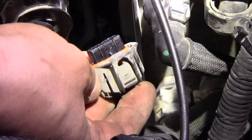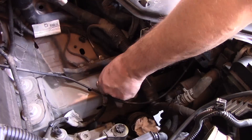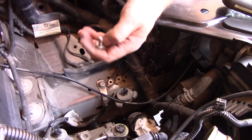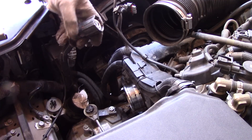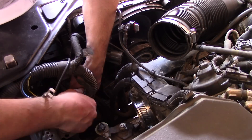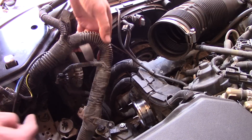Just push on the top and pull on the connector. Next, remove two ground cables from the chassis — there are two 10mm bolts. Take out the bolts and loosen the two ground cables. Next, disconnect the fan connector. Now we can pull the wiring harness upwards — but be careful, there is a plastic clip that secures it to the car frame, so detach it before pulling.